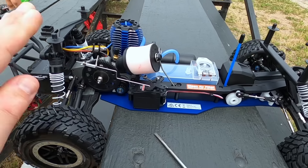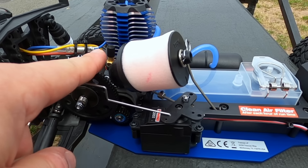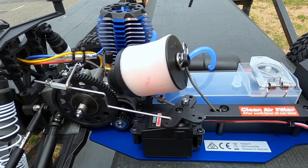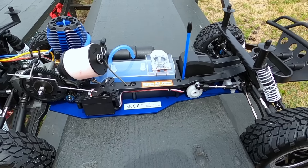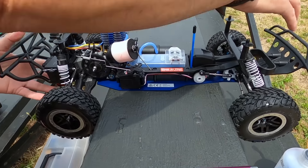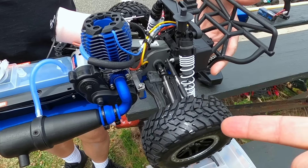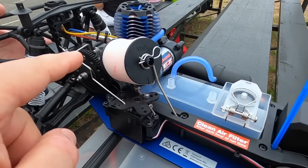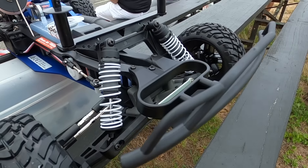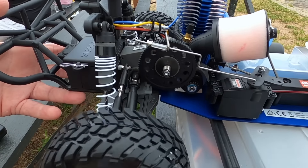When I lifted it, the wheels were moving too fast. This is the idle you want — makes sense. I'm also going to adjust the high speed needle. We want a little more smoke out the pipe. I want to get the low speed needle — this allows more fuel flow. It's basically a valve. That idle is sickening. Always hold it with the exhaust away from you because that stuff is smelly. The wheels — they're now not moving crazy. We're doing a little break-in. A good amount of smoke coming out here. I've tuned the needles a little bit better, also richening the high speed needle. The idle has settled down — it's consistent, it's reliable. Moving the wheels like this is normal, no big deal. I'm going to give it a couple minutes, we'll shut it down, and we'll do a little recap.